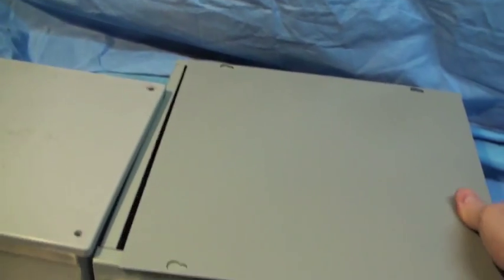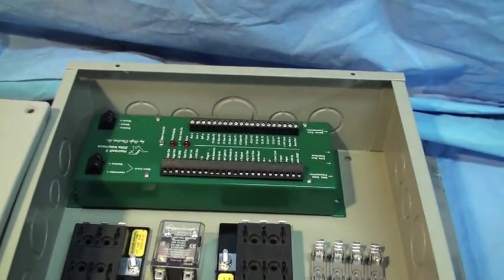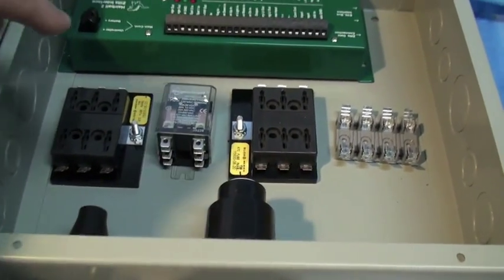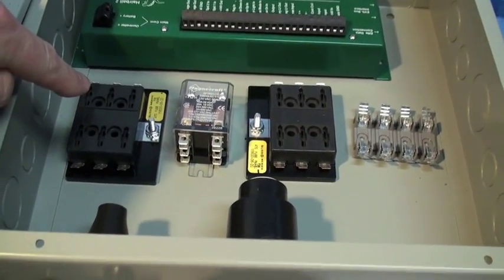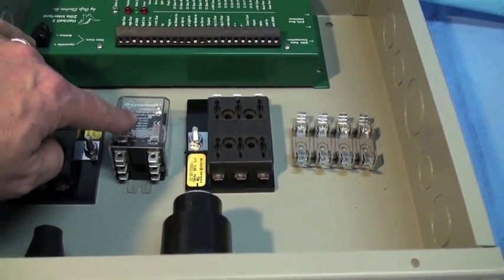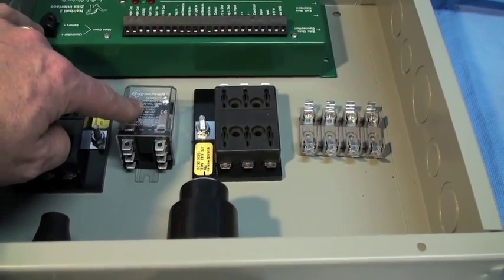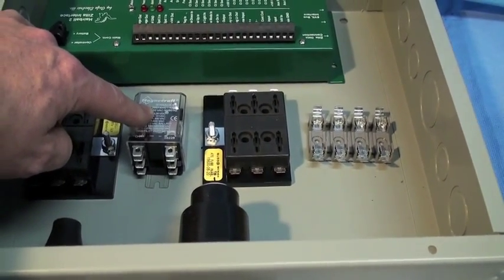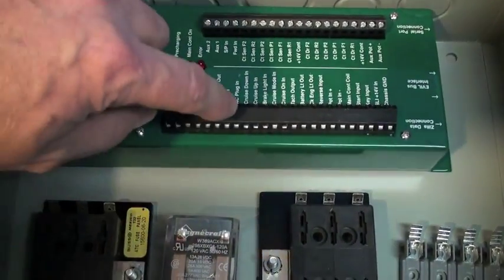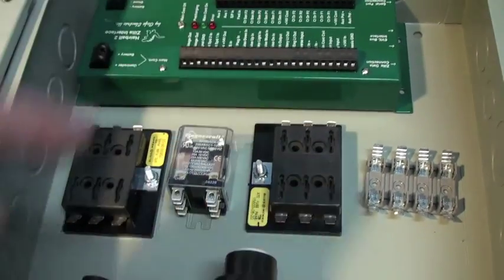On the inside of this box - take this lid off - I've got my hair ball. I've got two fuse blocks. One will be key switch on, will be hot. This will be hot without the key switch on. This is going to be my AC cutoff switch so that when AC power is applied, it will send a signal to this line right here - it says AC plug in - and it'll give me a 12 volt signal there that will turn the hair ball off.